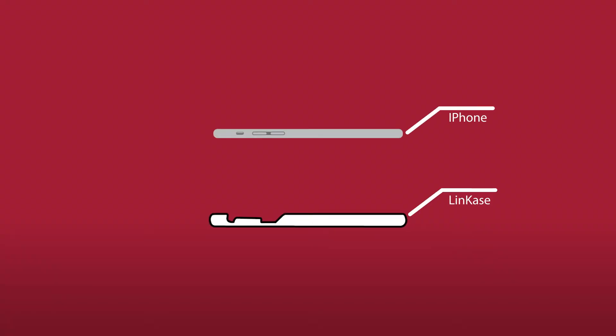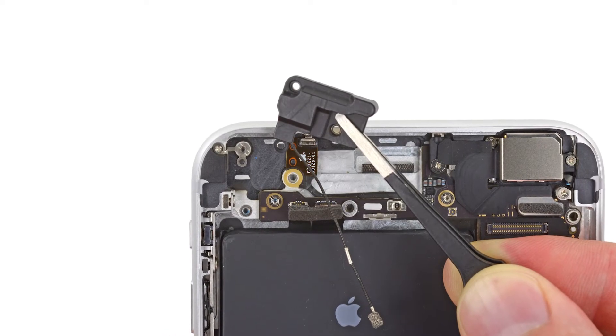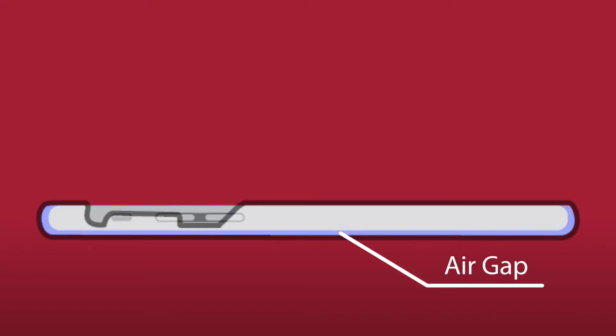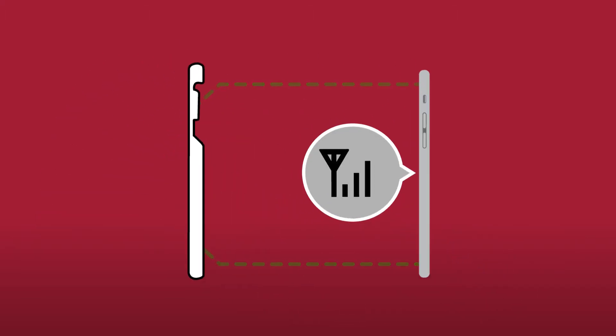It increases your antenna size and therefore should increase your signal. The problem lies in the way cellular signal is transferred. These antennas are not attached to the phone's antenna in any way. For an antenna like this to work properly, you would need a direct connection between the case's antenna and the phone's antenna. The way smartphones are designed, there's no way to directly connect to their internal antennas. The air gap between the phone's antennas and the case's antennas causes more signal loss than benefit. Without a direct connection to the phone's antennas, this case will provide very little if any signal increase.